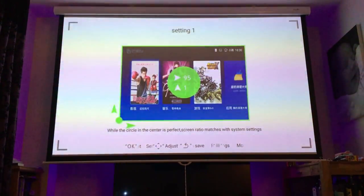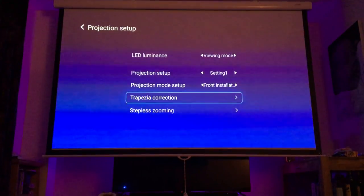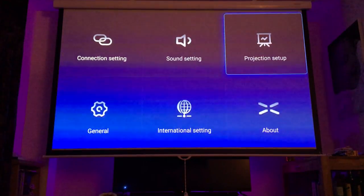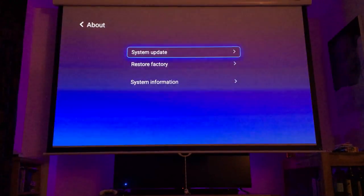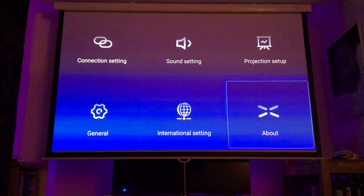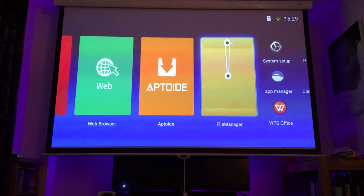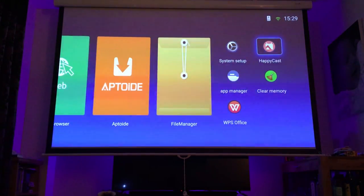The only way around that was to look online and buy a splitter, which some of these splitters would strip out the HDCP 2.2 signal, and that would allow you to play it, or buy something that would convert the HDCP 2.2 signal to a 1.4 signal, and that would then allow you to play it.